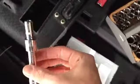Next step appears to be removing the bracket housing for the actual navigation computer, which looks to me like it's going to be a bolt right here. That looks like it could be about 8 millimeters. Looking around on the bottom, could be one there on the amp. A couple different parts, 8 to 10 millimeter bolts. I'll let you know how many there are when I take it out. Very straightforward. That one over here coming off this nut was just an 8 millimeter. I ended up using what looks to be a 3-inch extension with an 8 millimeter socket. It's a little hard to get to, but if you get back there and get your hands in there, it's not a problem to get out.